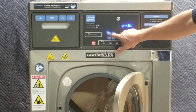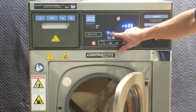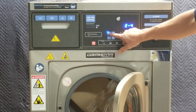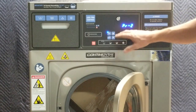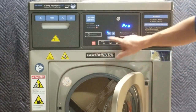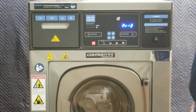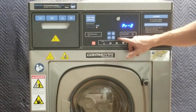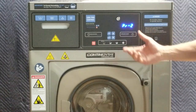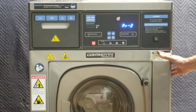Phase 11 we'll complete with high level, 32 degrees, no chemical injection, high agitation, five minutes, rinse only, extract speed at four, extract time at five. Now back to program two — it's completed. I hit stop, it goes back to programming. I hit stop again, it tells me the door is open. I close the door and now we're back at the home screen where I can select the program and hit the start button to begin. That's the basics of programming a Continental washer with the Logi or Logi Pro control.